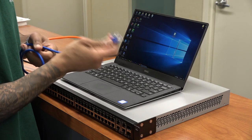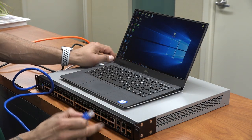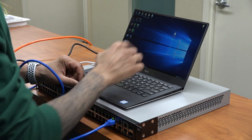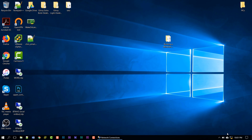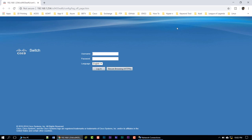We're going to take our ethernet cable and plug it into any port — I'm going to plug into port 24. It's already lighting up, which is good. On your desktop you should see an exclamation point indicating no internet access — that's okay. Now open up a browser and type: http://192.168.1.254 and hit enter. It's going to automatically launch the Cisco web interface. By default the username and password is cisco/cisco, but we need to change that.